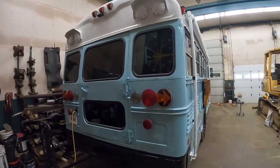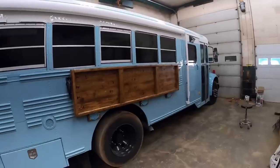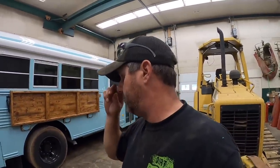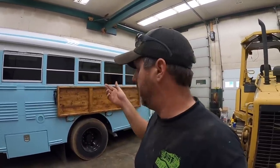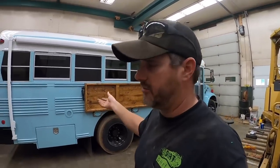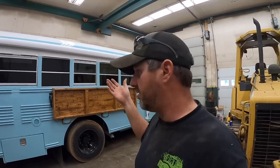We got one little issue we need to work on: the electrical system. This video is going to be operation rewire. So inside the bus we got an on-demand electric hot water heater that draws about 20 amps - it's a big boy. We got an air conditioner currently drawing about 10 amps; we're going to replace it and put a rooftop unit with a heat pump in, which will draw about 12 amps. We got a refrigerator drawing 3 amps, a battery charger for an inverter drawing about an amp, and some miscellaneous things. Add all that up and we're looking at about 35-36 amps.